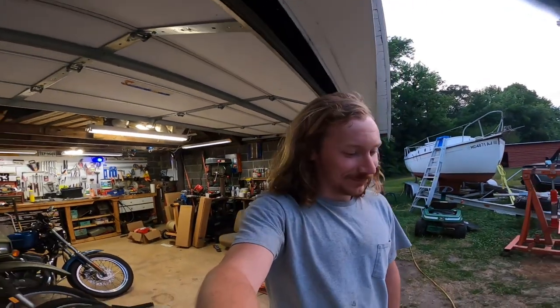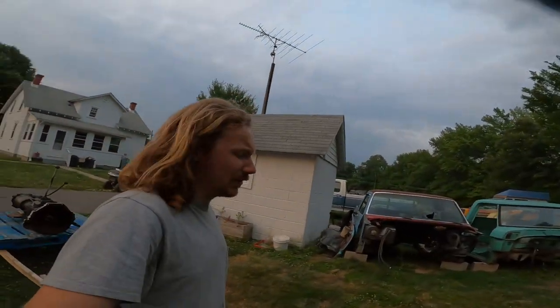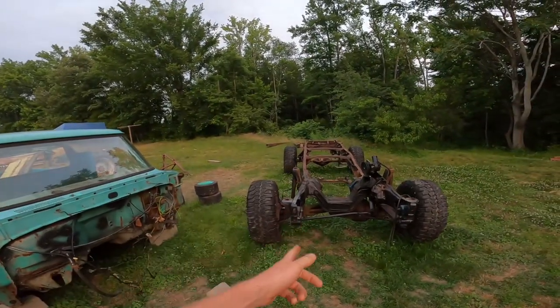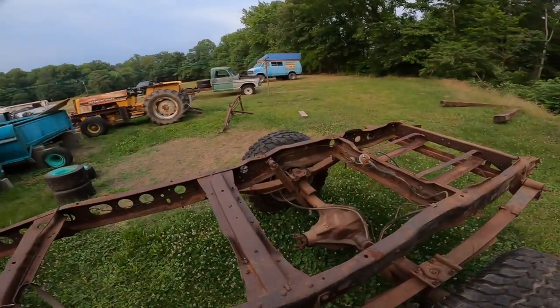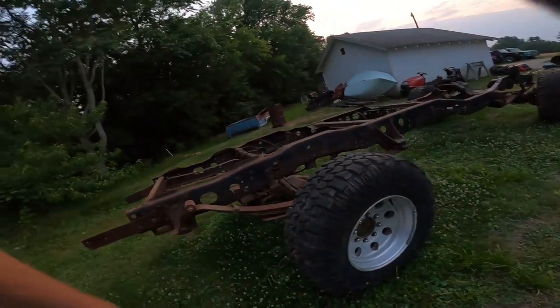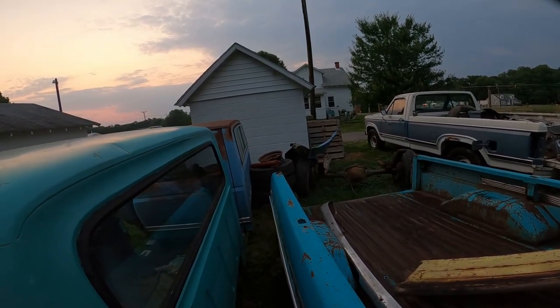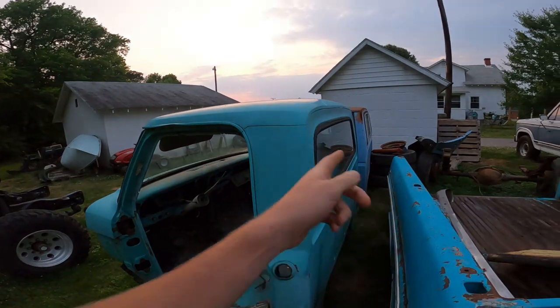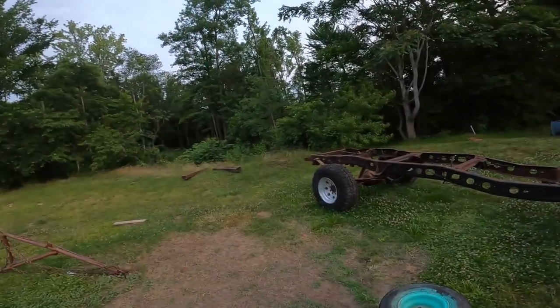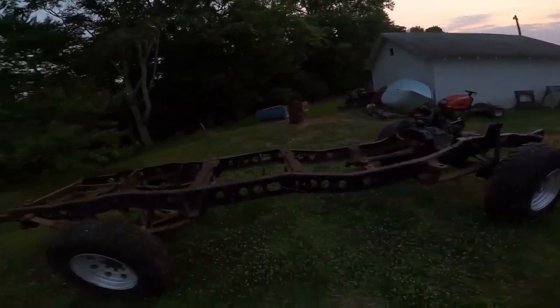That's it for this one — she's all stripped and ready to be fixed. In the next video I'm going to be doing bushings up front and rear: new leaf spring bushings, new axle pivot bushings, and new shackle bushings. I'm also going to be doing an axle swap. This is a Dana 60 — it's a semi-float axle. Back here I have a Sterling 10.25 full-float axle. It's heavier duty, it's got bigger brakes, and it holds more weight. We're going to use the existing suspension and just swap everything over. I need to order new U-bolts, but while it's all apart it'll be so much easier to do it. They're both 3.55 gearing, so she'll be fine — we might have to step up the gearing in the future.